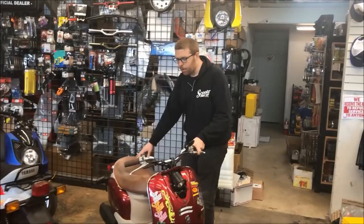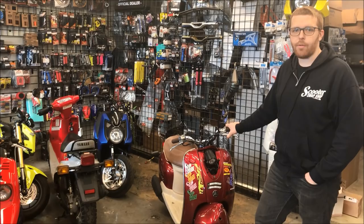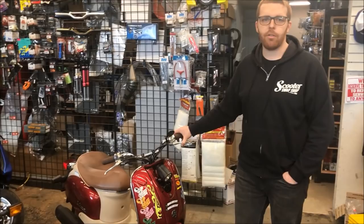The other thing too with the wheelie bike, if you have a little bit more power, you can get away with using a really mild up gear kit to get around maybe 10 or 11 to 1 final drive ratio. As long as you don't mind being capped at like 45, 50 miles an hour, I don't mind having stock gears because you can go down to that low, low, low wheelie speed.